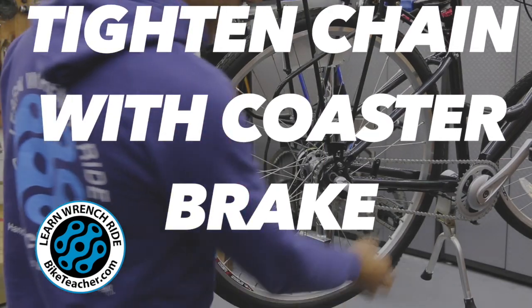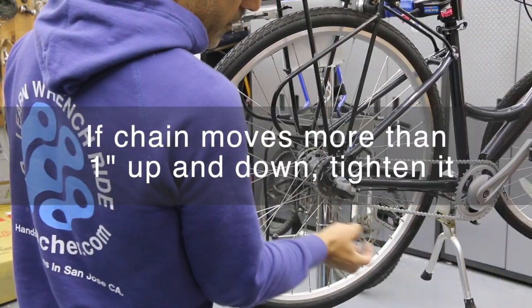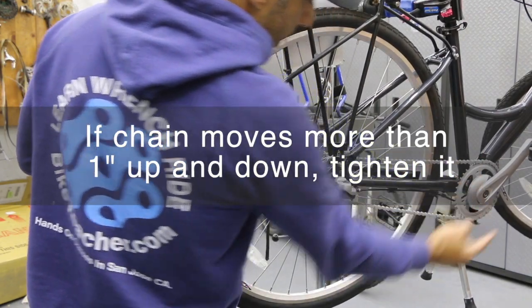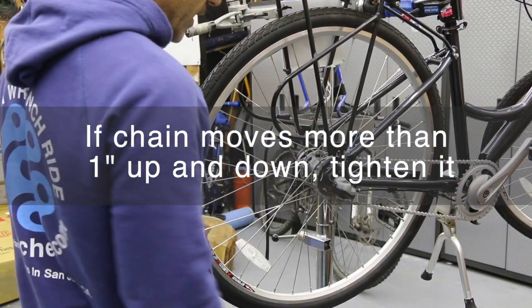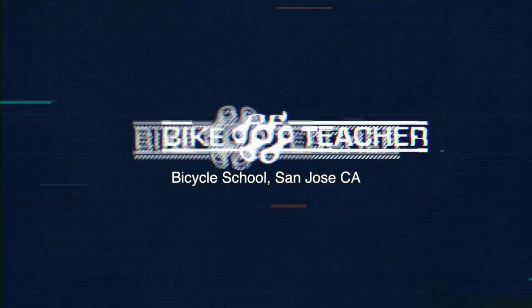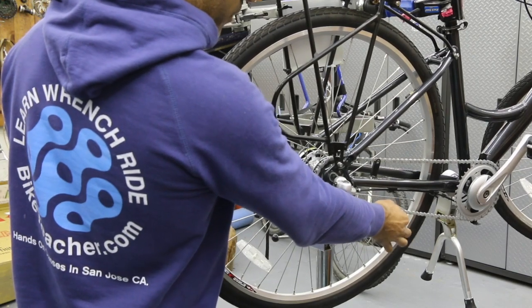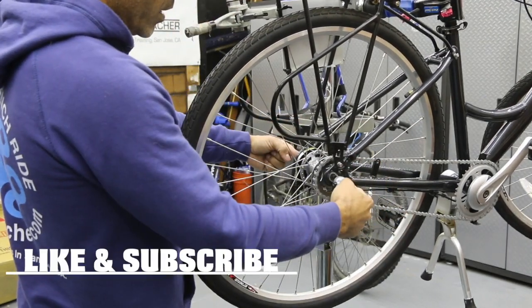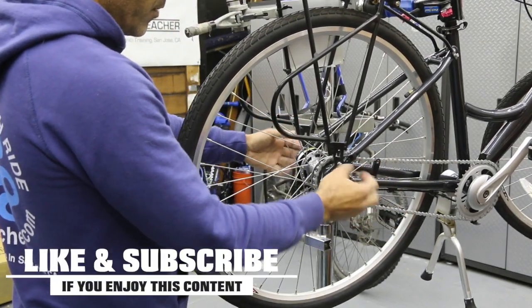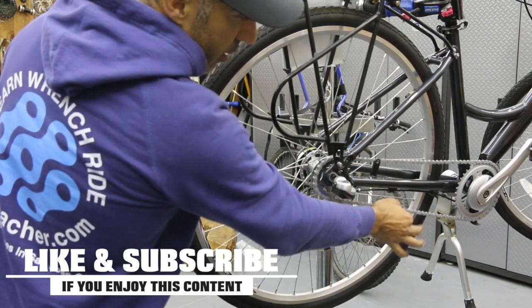So if we need to tighten this chain because the chain's a little too loose, again, if it is too loose, it could fall off at some point. It's either gonna fall off your front chainring or the rear gear back here, leaving you stuck. So if we need to pull tension, the two bolts that are holding the wheel need to loosen up and then slide the wheel back.